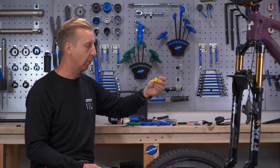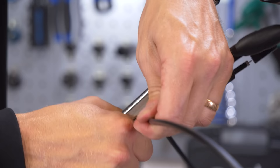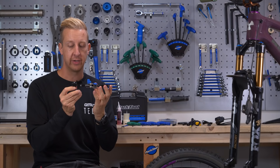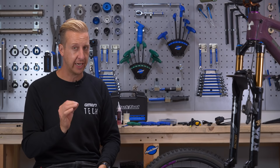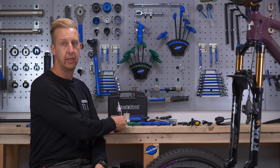Although there is a much better and easier way of doing it. Whilst you can clamp the hose in a vise with the supplied clamp and trim it with a knife for a pretty good effect, what you're aiming to do is trim the hose completely 90 degrees flush for the barb to have a completely water and airtight seal. Really, you won't beat the dedicated tool for the job. There are loads of options — Shimano, SRAM, and Park Tool all make one. You can trim the hose and use the little clamp at the end to push the insert straight in. If you work on brakes a lot, it is worthwhile getting one of these tools; otherwise, just take care because that cut has to be a really good 90 degrees, or you can't guarantee good brake performance.